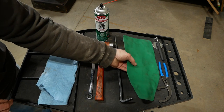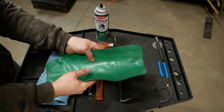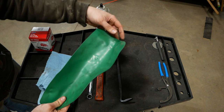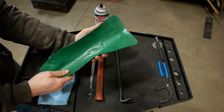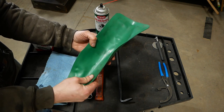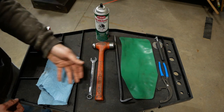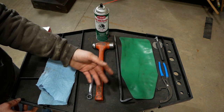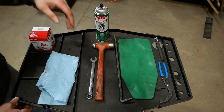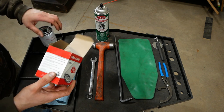And then this is the real secret right here. This is called a Forma funnel. It's just a piece of rubber with some metal inside that's really malleable. You can bend it and shape it and literally form a funnel in any configuration you can imagine. What this is going to let us do is create a channel for the oil to run out of the oil filter without getting all over the whole bottom side of the engine. I'll put links in the description to where you can buy any of these tools. Now I realize not everybody has a Forma funnel even though you should — it's super handy. So we're going to try a low buck alternative. I don't know if it's going to work or not. We'll find out.